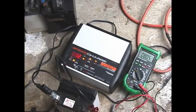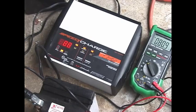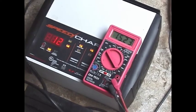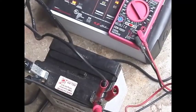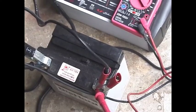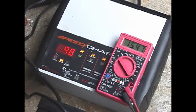I'm charging up a Sears Die Hard, just to show you how it goes. It's showing 88%, 89%, and when it turns on you can see the voltage immediately starts jumping up — it's 15.2. This is the motorcycle battery. It was dead, sat for three years in my motorcycle. The two end plates were dry, had about half water in them. It was measuring 7 volts when it started. After a lot of charging it came back up, and now the resting voltage is like 12.8, with battery capacity around 100 cold cranking amps.